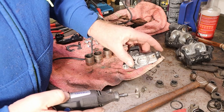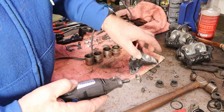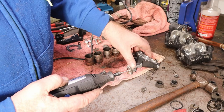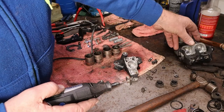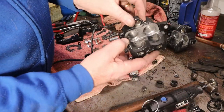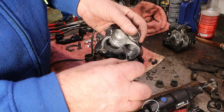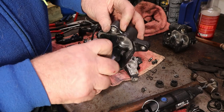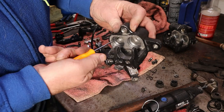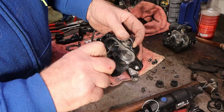That'll pretty much do it for our O-ring grooves - it really makes them nice and gets all the junk out of them. This thing's light enough it's not really taking out aluminum, it's just cleaning up the junk. You see in these grooves it doesn't quite get all the way down in the very corners, so we come here with a pick and just work it around to make sure all our little corners are cleaned out.